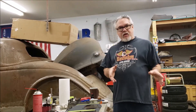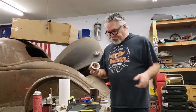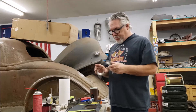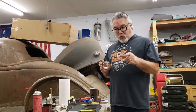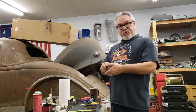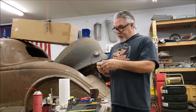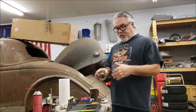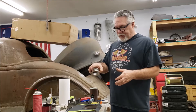I've taken the crankshaft out of the block and I've got the thrust bearing here. I've marked both shell halves with a Sharpie indicating forward on the block so I can keep these together when I do this procedure — I want to keep them relative to each other so that when they're installed back in the block, both halves have been homed together.